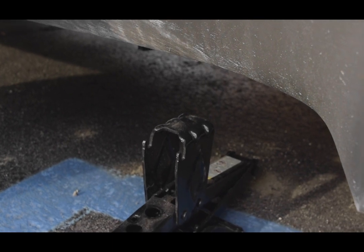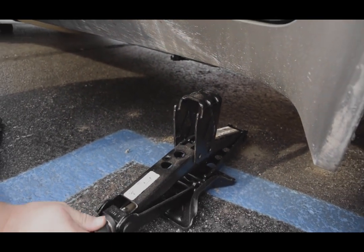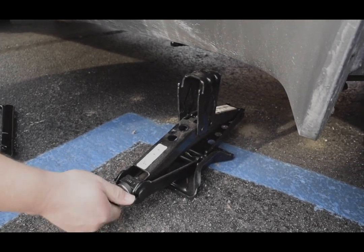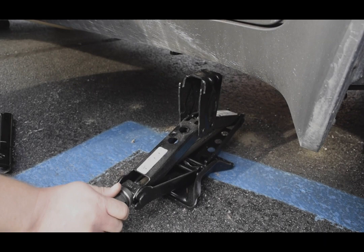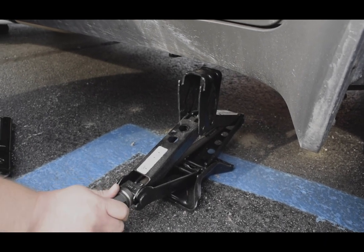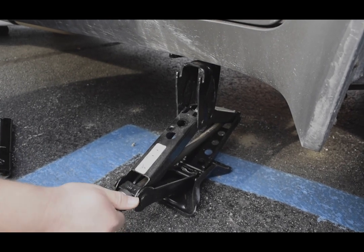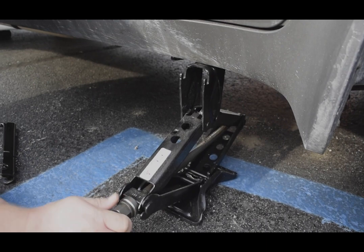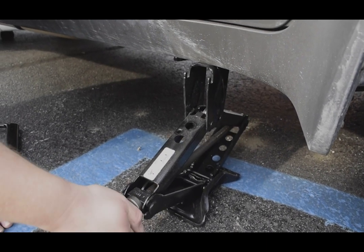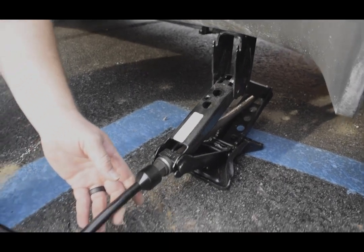If your car has a little bit of excessive rust or doesn't feel solid, the best bet is to look underneath and find what appears to be something solid to locate the jack on, because you definitely want it to be as safe as possible while your vehicle is in the air. You can turn it up by hand until it gets in the proper location, and then use your jack handle to get it the rest of the way up off the ground.